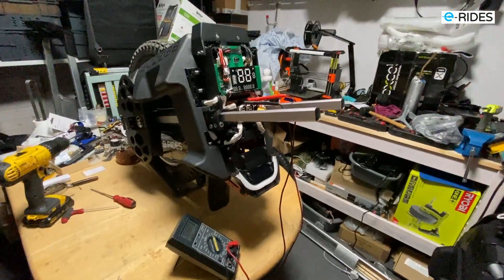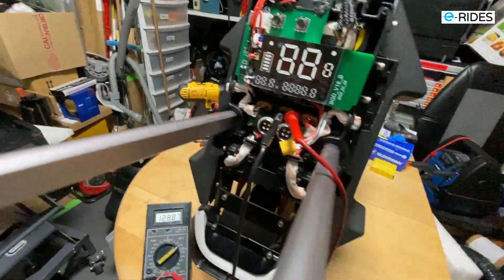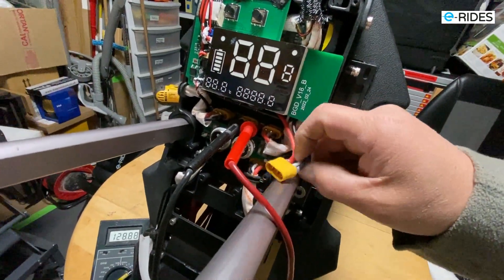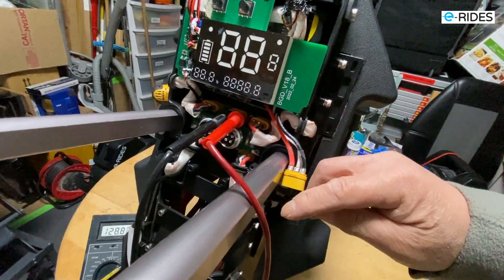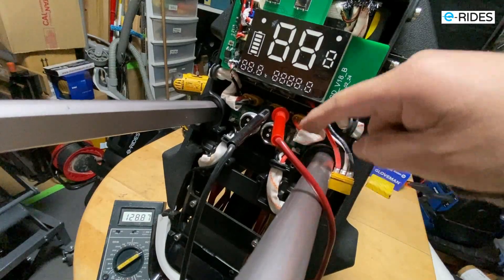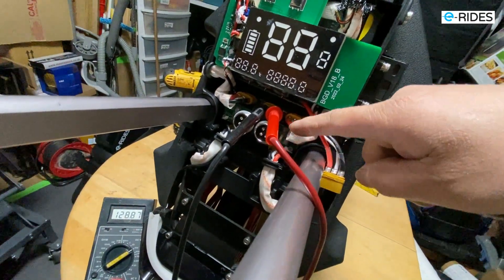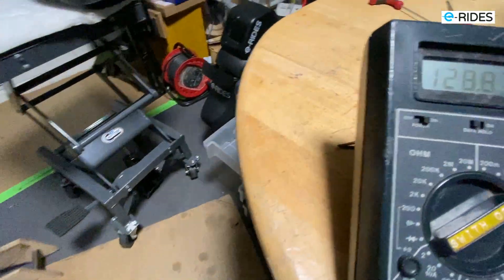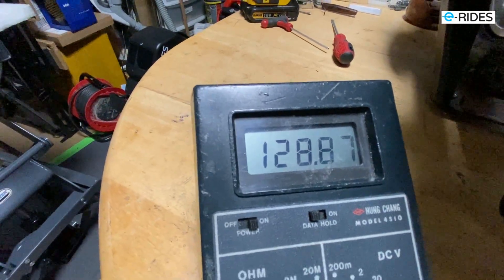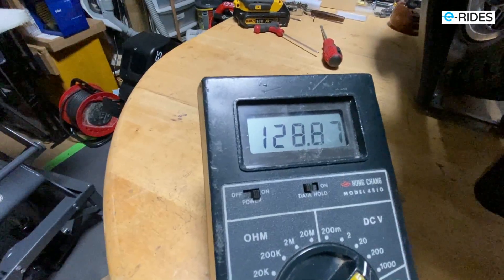It's on the bench — here we've got the master. What I've done is disconnected the power to the control board. I've got the full battery plugged into the battery connector management and the charging socket. I'm measuring the voltage on there at the moment — it's giving me 128.87 volts. Obviously it's been ridden and the battery has gone down. So that's what I'm reading at the moment.